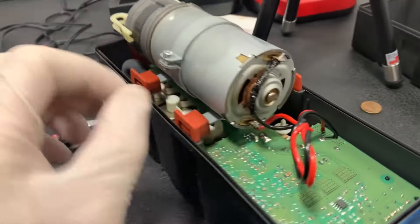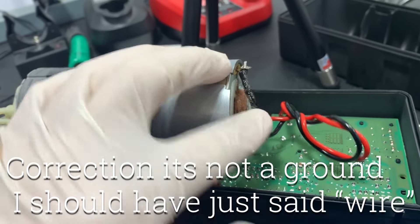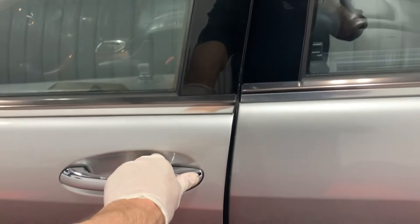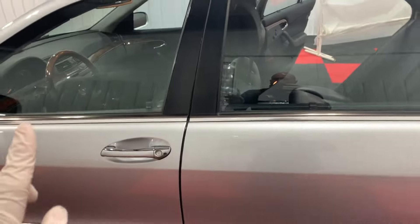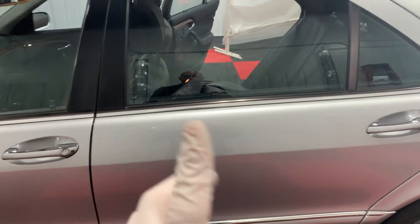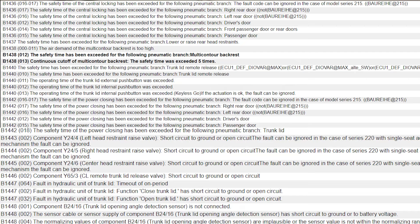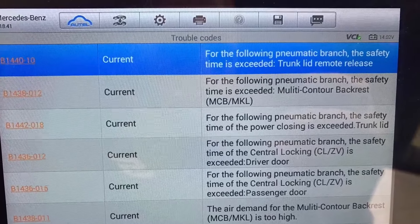I took apart the PSE and this is what I found — the ground wire is burnt to the motor. Look at that, rusted and everything. So this is the culprit. The second problem you'll run into is these cars have a soft close, where when you put it to the first click, the PSE is supposed to suck it into the second one. So if you have one door that doesn't work but the other ones work, or the trunk lid won't pop open — once there's a fault code set in the PSE control module for a leak in the system, it cuts the operation to that circuit to prevent the pump from failure. If you have a fault code for every single circuit, that's a dead giveaway that the pump is bad.